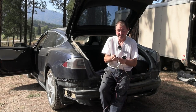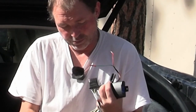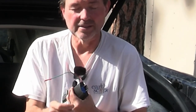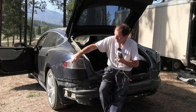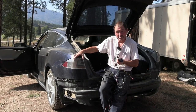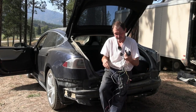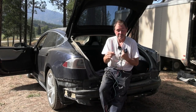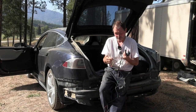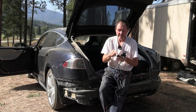So why does it power up the trailer lights too? Well, it's not actually that one that powers up the trailer lights. It's actually the brown one that's for the tail lights, because when the brake is on, the tail light one gets powered up too, because the tail light, the outer ring here, gets bright as well. So this outer ring is dim for tail lights and bright for brake lights. So it is the brown wire here, and it gets a signal when you step on the brake as well as when you turn the tail lights on. So either way, when the tail lights are on or when you step on the brake, it puts out to the trailer as tail lights. And obviously if you're on the brake, then left and right will be powered up too.